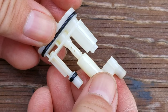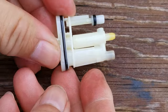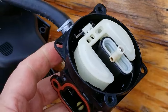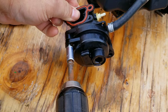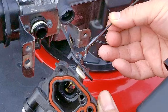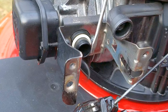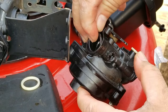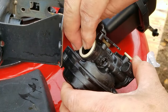This mower's story is pretty much what I see every spring when consumers try to get their mowers out for the first time. Also, the primer bulb will only fit one way — if you try to put it in the wrong way it won't sit properly, so do not force it. I did make a mistake: when connecting the governor linkage I realized the o-ring and its retainer were still on the intake pipe. These need to be taken off the intake pipe and put back on the backside of the carb for them to seal properly. If not, there's a really good chance the engine will either not start at all, or it'll start but won't run very well.